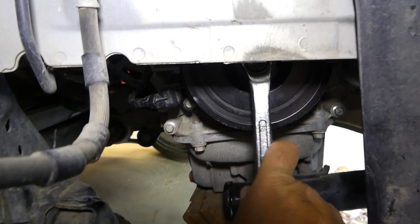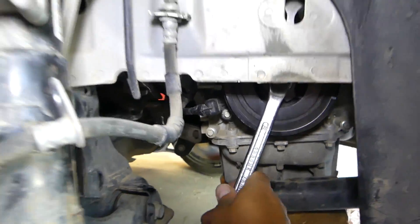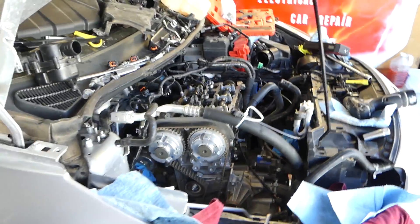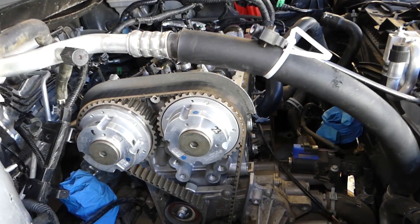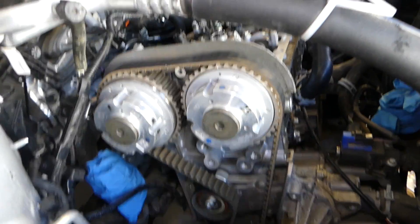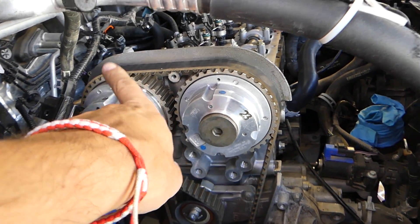Listen — that's it, right there, it stops. We have a special video on how to set the timing if you're doing a timing belt or anything like that. If your timing is correct and you're at TDC, that dot and that arrow will be pointing up.